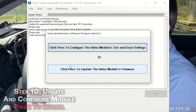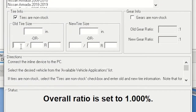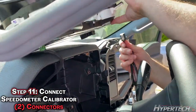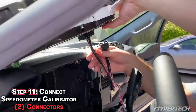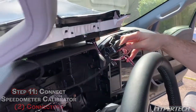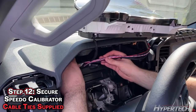Before you plug this in, you're going to want to make sure that you have updated this on the computer — that you've put in the correct tire size, the correct vehicle, and all that information. Once you've done that and downloaded it to the device, you can go ahead and connect right where the other plug went to the back of the bezel.